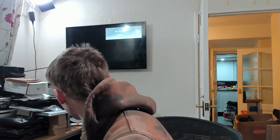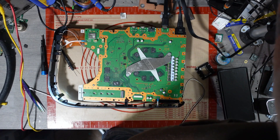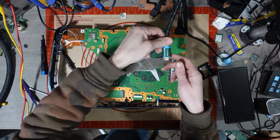Interesting — no display. Does it recognize there's a PS5 there? We've got no display. The HDMI cable feels a little loose. If I recall from an hour ago, this has had an HDMI port replacement — so has it been done wrong? Have they bridged it or completely butchered it? Let me disconnect this HDMI cable and connect just one, because sometimes the splitter setup gives me issues. It doesn't quite reach so it's a bit of a stretch — does it pick up now? No, it doesn't.